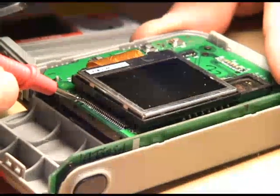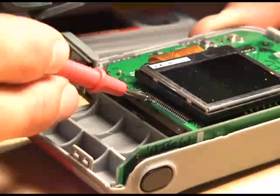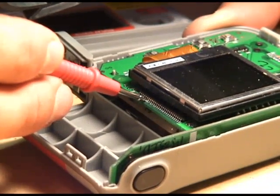Find the RAM module behind the LCD. Starting on the bottom pin, count up to the sixth one. Take the probe from your multimeter and bridge pins six and seven. While they're still bridged, unplug the USB cable, wait a few seconds, plug it back in. Hopefully you'll hear two death beeps — they're very distinct, you'll know what they are. If you did, great, we can move on. If you didn't, just lather, rinse, repeat until you do.